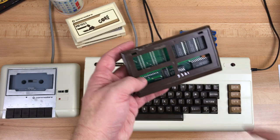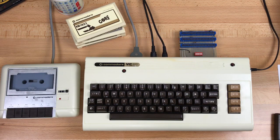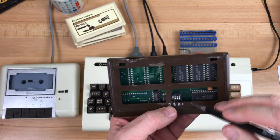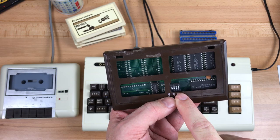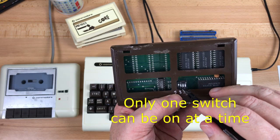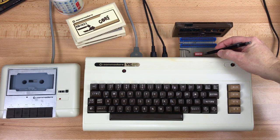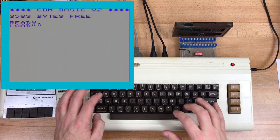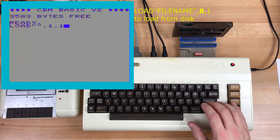Now that it's saved, you can give the cartridge back to your friend. When you want to run it, you need to load it into a RAM cartridge. This is the cartridge I used back then — it has the cover stripped off so I can get access to the switches inside. These switches set the memory range. The default is block 1 so it can expand BASIC memory. The fourth switch is for block 1, then 2, 3, and 5. So you want to set your cartridge to block 5. Then on the slot expander, turn off everything but block 5 for the last slot. When loading the saved cartridge, you have to load again with the comma 1 option so it loads back into the original memory space.